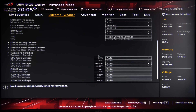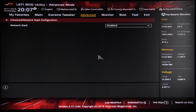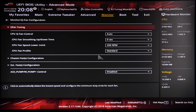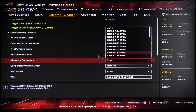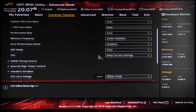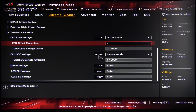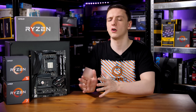Jumping into the BIOS — as with all Asus motherboards, they're basically the same BIOS. You have a few extra settings on this one compared to, say, an Intel board, with AMD CBS settings which let you set things like custom P-states if you really want to go into advanced overclocking. The overall BIOS layout is pretty nice, with most things split up into individual tabs and a tools tab for fan monitoring and fan profiling. When it comes to overclocking, the board literally has a submenu called Tweaker's Paradise, where you can change literally every voltage, every timing, every setting imaginable. If you're a beginner, everything is on a simple page and you can easily jump through their 4 gigahertz profile, gamer profile, and similar presets.